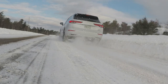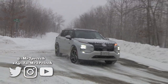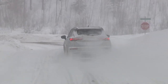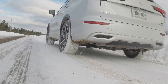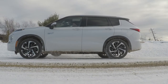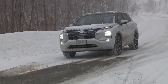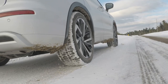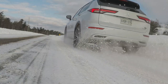Like all vehicles with motor-driven axles front and rear, the Outlander PHEV does away with these constraints. There's less hardware — clutches, differentials, drive shafts, and gear sets — in play. Electric motors respond instantly and aren't constrained by mechanical components. This gives drivers access to a broader torque split than a clutch-based system and more single-axle torque than a differential-based system, all with the immediate response of electric motors. According to Chief Engineer Kentaro Honda, this AWD system can make on-the-fly torque split changes about 17 times faster than a mechanical system.